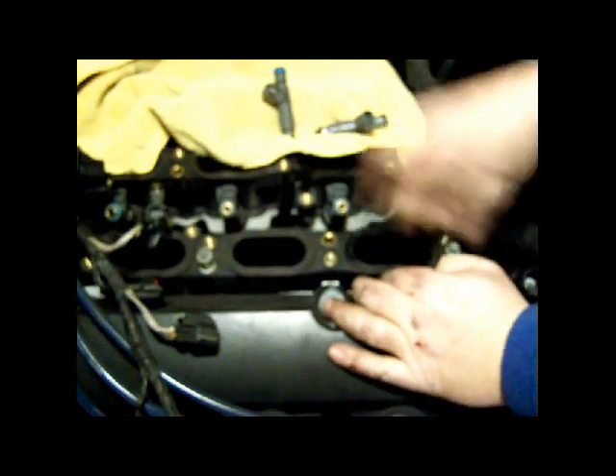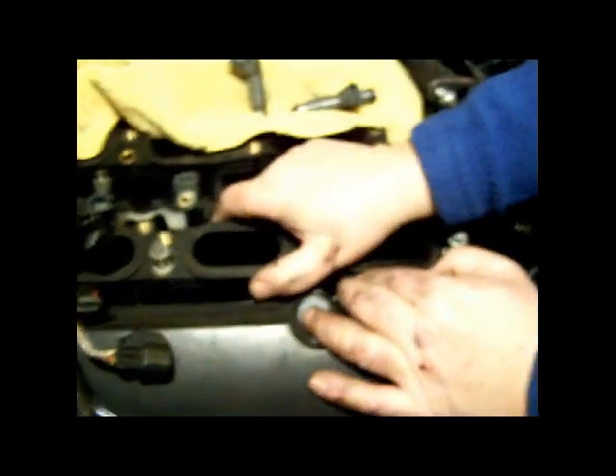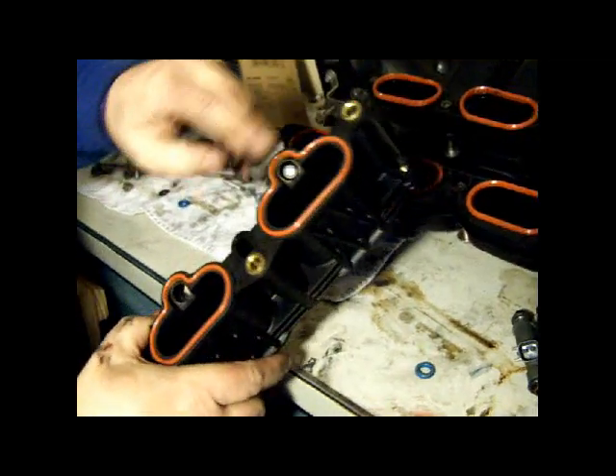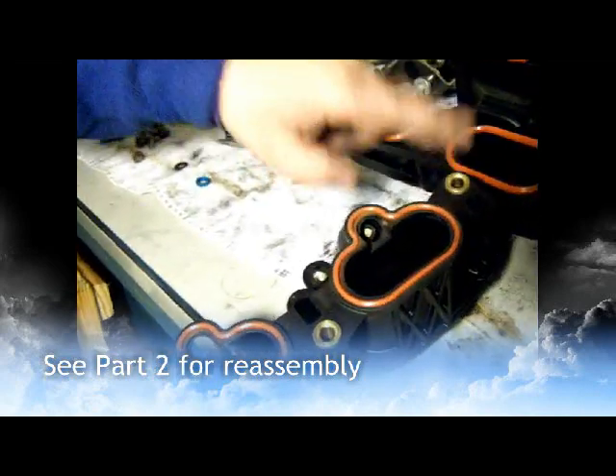What we're doing now is I've decided to pull off the lower intake manifold as well, just to make sure that as I'm pulling these injectors out, I don't risk losing an O-ring down the intake. There were two more bolts to take off for that, and now that's off. If you look down there, you'll notice it's just straight open right into the engine, so I'm going to take a rag and cover this up. Again, I don't want to take any chance that something falls down in there. You can see the lower intake gaskets — also new — and you can see how the injector is right there near the intake of the cylinder.